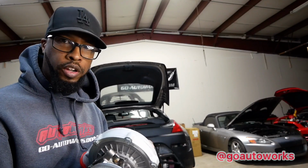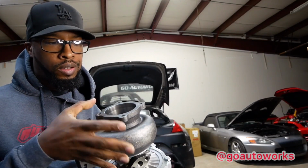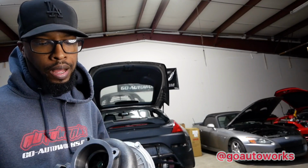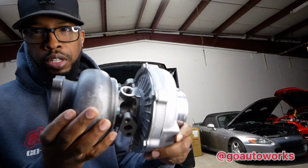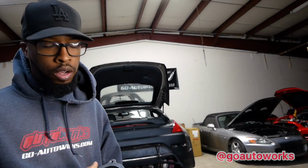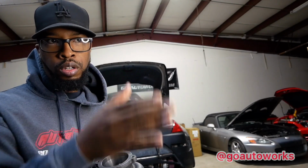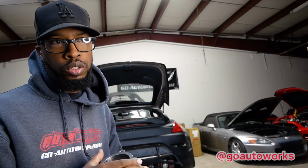Okay, what we've got here is their version of the GT30 T3 housing, and they use this extended GT 4-bolt housing that uses a 3-inch flange. Garrett does this option as well. I never use these on Honda applications, only because of how long that housing is. I typically use a narrow T31 standard 4-bolt housing that doesn't take up as much space. These are hard to use on front-wheel drive apps where it's a bottom mount turbo, where the turbo is typically centered between 2 and 3 on the motor. It puts the downpipe out too close to the radiator.